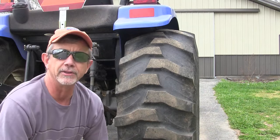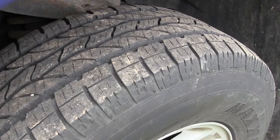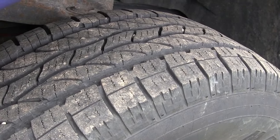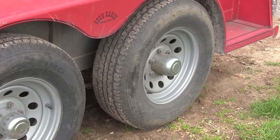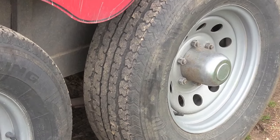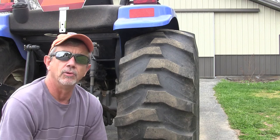The reason I wanted to bring that up: in my pickup truck tires, horse trailer tires, any trailer tires, I usually try to run about the maximum inflation. I do that for a couple of reasons. Number one, I'm not really worried that much about the ride because I've got springs under me to make a better ride. Number two, you get less rolling resistance and better mileage when you have more air in them. So I inflate almost to the maximum. And number three, I think you get better wear on your tires.